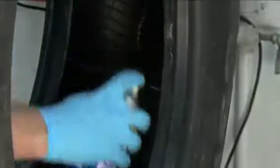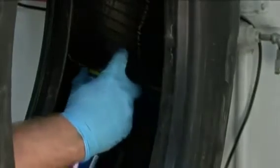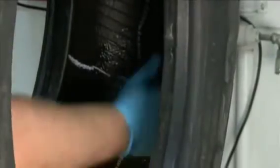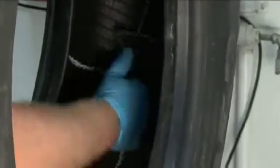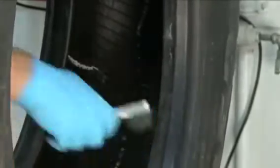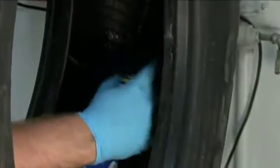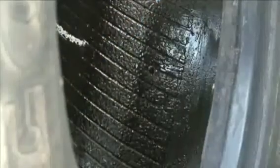After removing the inspection tool, pre-clean a large area of the inner liner by applying number 816F Buff Sol rubber cleaner. While the area is still moist, use a rubber scraper to remove contaminating substances. This process should be repeated 2 or 3 times to guarantee complete removal of contaminants, such as silicone mold lubricants used in the tire's manufacturing process. The important thing to remember is the area must be cleaned.